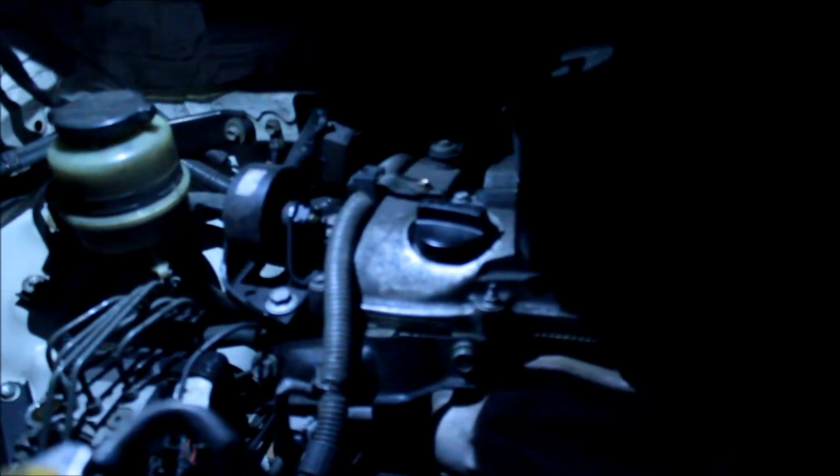Right, so now the oil filter is back. Screw the bolt back to cover the engine oil tank, and here's where you need to pour the engine oil through. So just undo this, put that somewhere, get something like a funnel and put it in here, and then you pour the oil in.